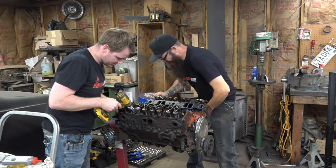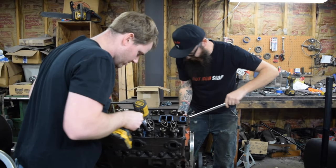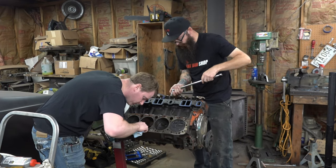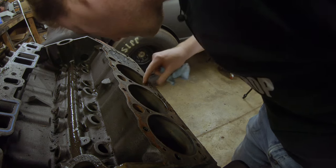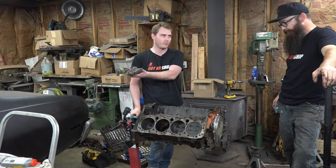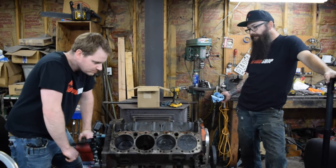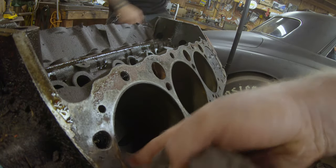This is a truck engine, came out of a '67 Chevy pickup. Even still, in 1967 basically all the engines they were putting flat top pistons in, which is way better than what that 350 came with in 1972. There's a teeny tiny bit of a ridge in the cylinder but not bad at all. We'll throw the dial bore gauge on them — the point is to get an engine in the Nova that might even have a little more power than the 350 so the Nova still runs while we rebuild the 350.